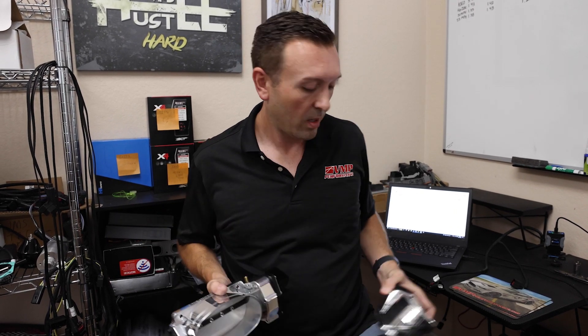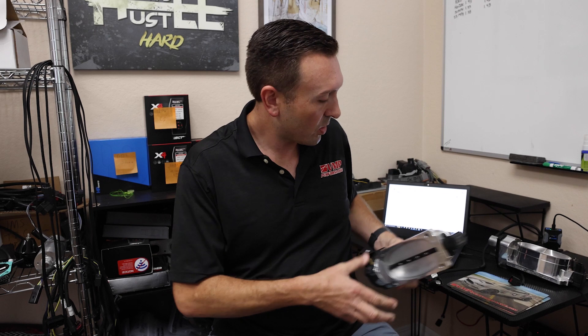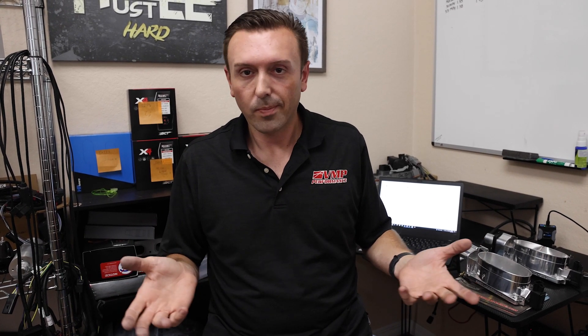The tried-and-true twin blade is the go-to. Other manufacturers do it a little differently — they've got maybe a twin and a mono, some use a big round mono in a couple of different sizes. The smaller you make the mono, the less surface area the blade has, and the easier it is to crack open in high-vacuum situations. So there's logic and reasoning behind why they do that.